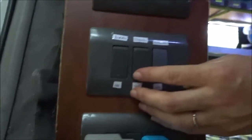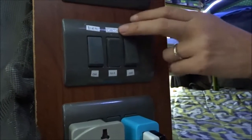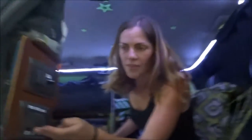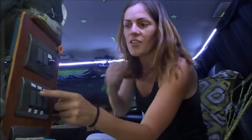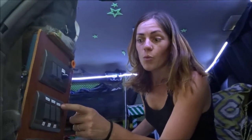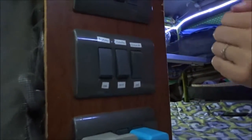When these are both on, it means the system is just running normally as designed. But if we're going to be sitting on the mains for a few days and want the inverter turned off, we can just turn the inverter off. The isolator — when it's on — means the batteries will be isolated when the voltage gets too low; if it's off, the batteries are disconnected completely. For example, if you're in a place where you need extra juice for your starter battery — like up in the Altiplano — you can turn this off and it'll hold more power in your starter. We also have an override: if we want to connect the batteries for any reason, say we just need a little extra power, this will force the batteries to come together and override the isolator. We almost never use that.